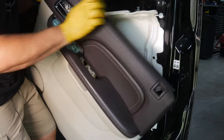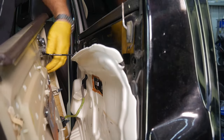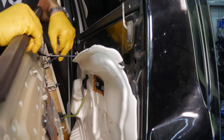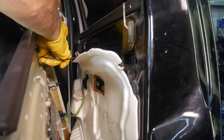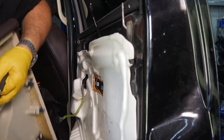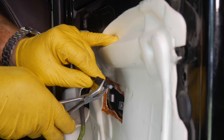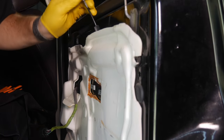Now all we have left is our door handle connected by this cable. For this door handle clip, take a small bent pair of needle nose pliers with smooth jaws, reach in, and depress two sides of it to pop the clip out. You can rotate it in your fingers if needed, then slide it off the door handle. You've got these two prongs that you have to depress — squeeze those together, pull it out, and then release the knob from the lever.